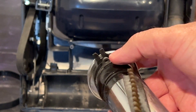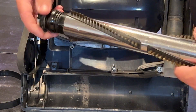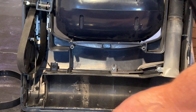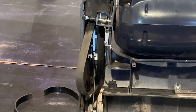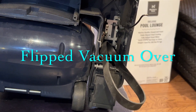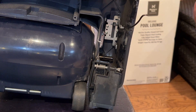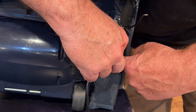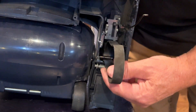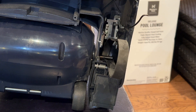Take that off, and there's a little spring that slides into a little hole here. When you're going from carpet to floor it'll engage and disengage. We'll put that back in later. To put the belt in, you simply slide it — there's a gap between the pulley and the wall of the vacuum — so you just pop it around there and get it on just like that. That's all you need to do.